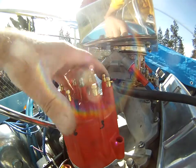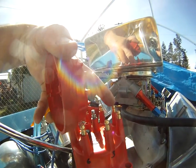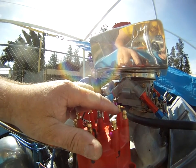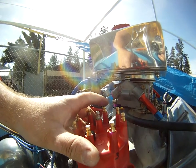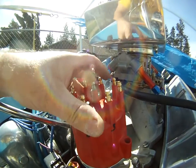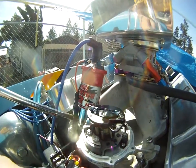When you advance your distributor to get your timing, you still want the rotor to be pointing exactly at that wire for number one, because that's where you get the best and most consistent spark. That's why they want you to phase your rotor. Everybody says drill a big hole in the top of your cap, use the timing light and look down. But here's another option I have not seen on the internet, and I believe it'll work.